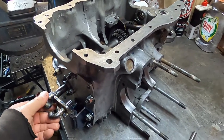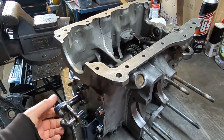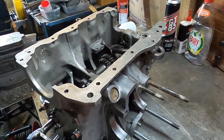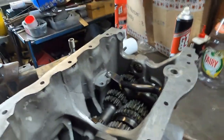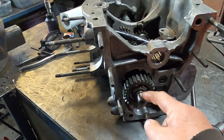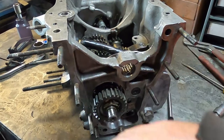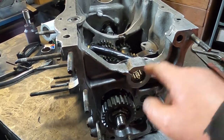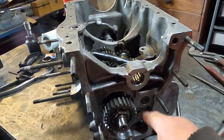This was originally a remote type gearbox used on the early Cooper S's and such like, as opposed to the later rod change gearbox. All I've got to do to the front is put on the bearing that runs in the flywheel housing, and the idler gear that goes up to the primary gear on the crankshaft. Again these are straight cut gears on this.